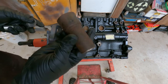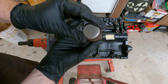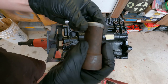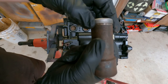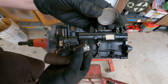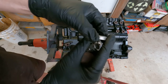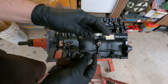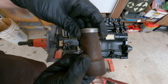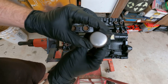All right, so we're going to use a drift, big chunk of metal, around the exact size or bigger than the Welsh plug itself. That'll get it the bulk of the way until you hit the edge of the engine block. Then we're going to turn it around and use something that's a bit of a snugger fit on the inside. Ideally, if you could find something that comes right to the very edge of the Welsh plug to knock it in. Beware of knocking something in with a smaller socket from the inside. You can end up bowing the Welsh plug and it'll reduce the crush on the outside, which means later in life it might pop out. But it's generally okay if it's a nice snug fit to hit it home the very last way, but make sure it's at least a few millimeters clearance on the outside.